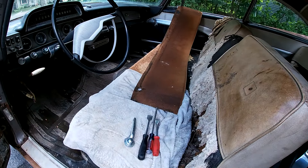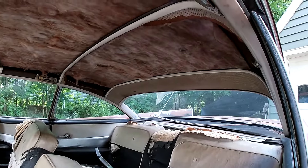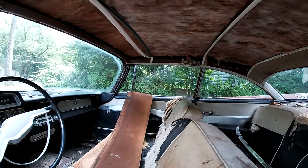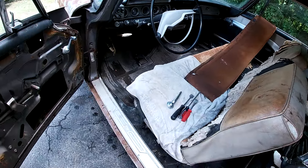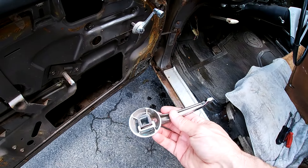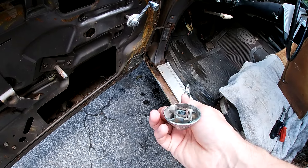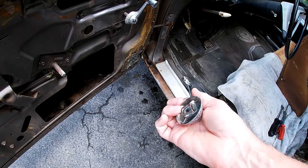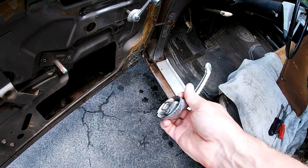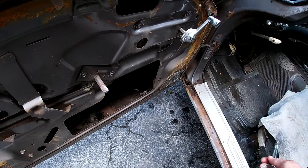There's what the sun does to your car when it sits out in it for too long. I've got one more panel here to fall down, so I'll probably remove it all. Going to remove a lot of stuff to get this going. Removing these door handles and the door pulls and the window cranks — there's a clip in there and you have to find where it is, where this end of it is, and then you push it out and pull it off because it locks into this groove.